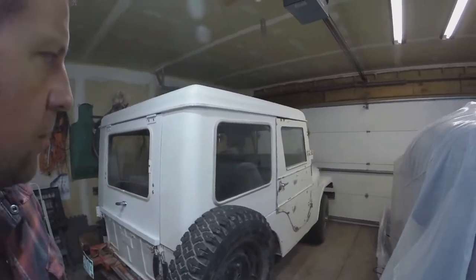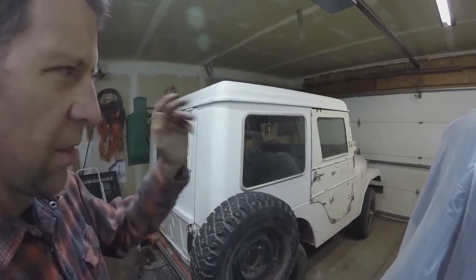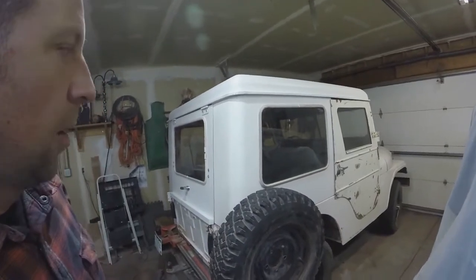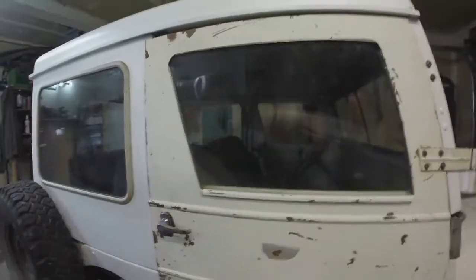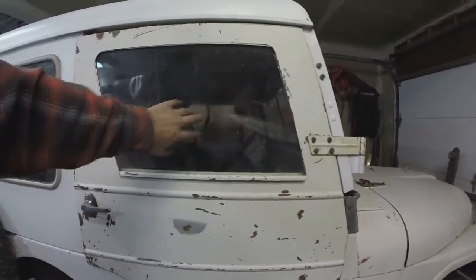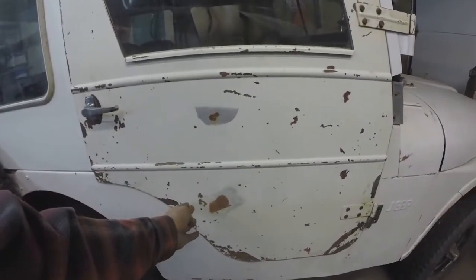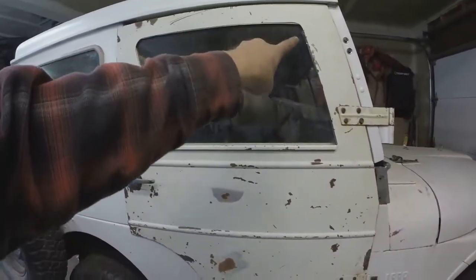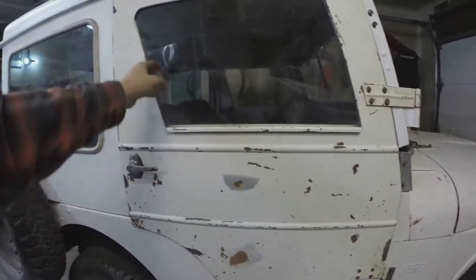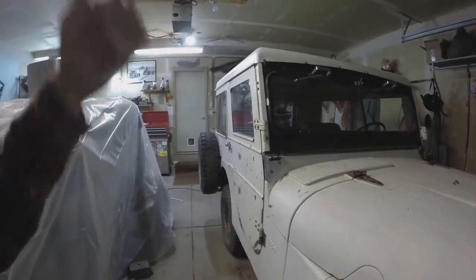The details — I don't know if I ever put this out there, but this is a Meyers Jeep top. This is something they put on aftermarket — you'd get it and you could get a new Meyers Jeep top. They also did plows and different kinds of things that go on the Jeep. But this top is special because if you look at a lot of these early Jeep tops for a CJ5, the windows didn't roll down. They'd have a slider back or the window was real short because you got to deal with this hump — you don't have a lot of room inside the door. So the Meyers top was specifically designed to allow the window to roll all the way down with a full-size window, which is why it has this goofy angle on it and why it looks kind of funny there. It'll be really great. The doors — you just swing them out, lift them off, and they go off the car. So in the summertime, I can just swing the doors off.